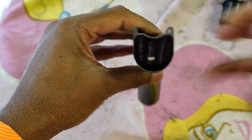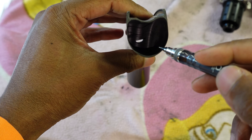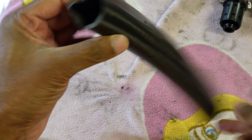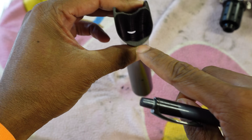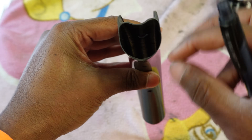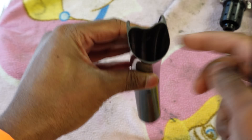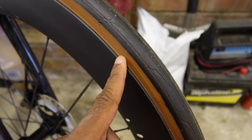Where there's no nipple, it goes back to a thin section. On the cheaper, heavier wheels they tend to have that thickness all the way through, which makes the rim heavier. On the really cheap wheels there's no reinforcement at all, so you've got that thin section all the way through.